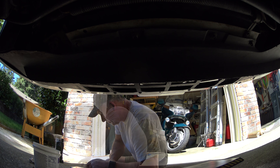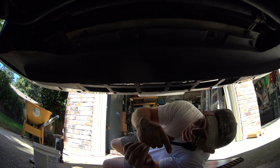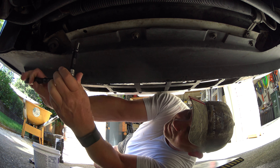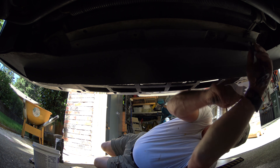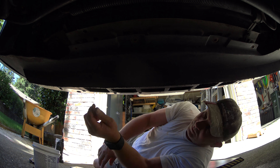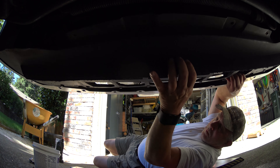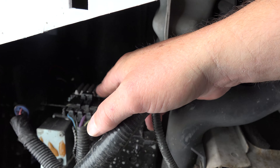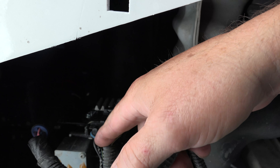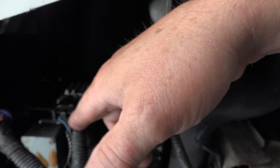What y'all doing? Okay, well that was some neighbors from across the street bringing me some wood to burn — like I need a fireplace right now. And out she comes. There are just some hooks here in the front, so just pop those hooks out. Now that I have the air dam out, this is the relay for the air compressor motor. These are the signals coming from the computer — the blue and white and then ground. And then the heavy purple — my guess is that's the 12 volt coming off that fuse.